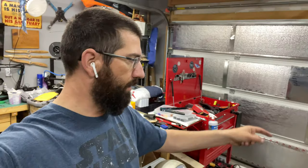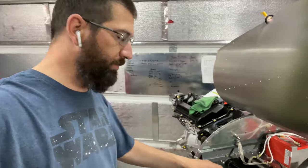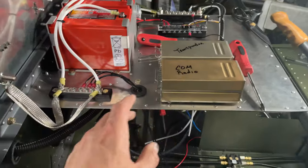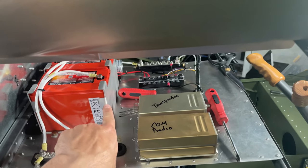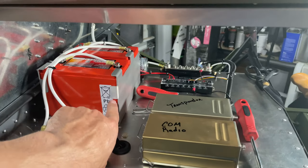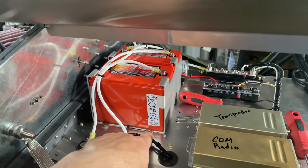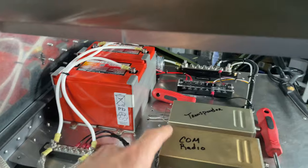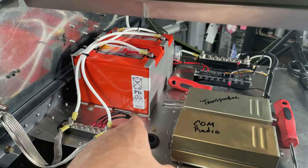Welcome back to the channel. I haven't been doing a lot of time lapse on this because I just want to make sure I get this right, and I've been really paying attention to how I'm doing it. I redid everything inside here now that I got my battery mounts. I went ahead and redid my battery mounting and wiring. I now have the mount that Viking Aircraft sells, and man that works really nice. I bolted the back one in, then used nut plates and Phillips head screws to hold the front end. That way when I need to change out the battery, I can just pull this panel up and unscrew those and swap out the batteries — easy peasy.